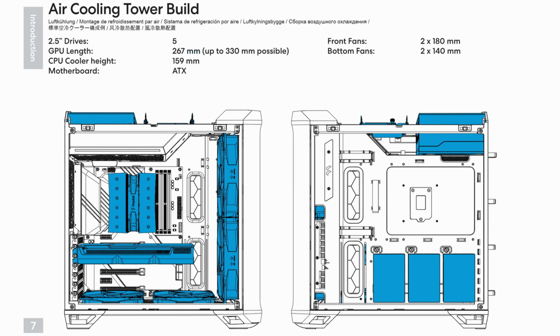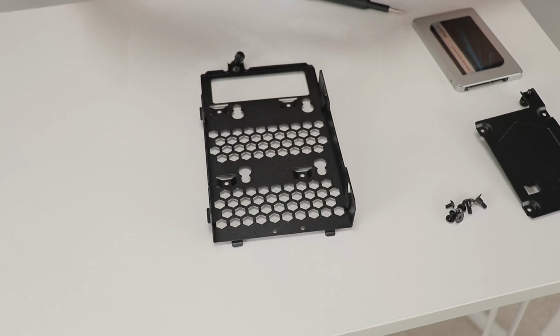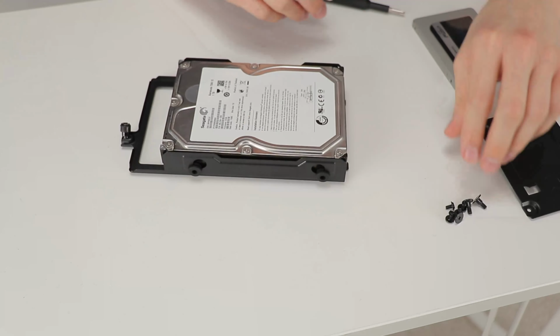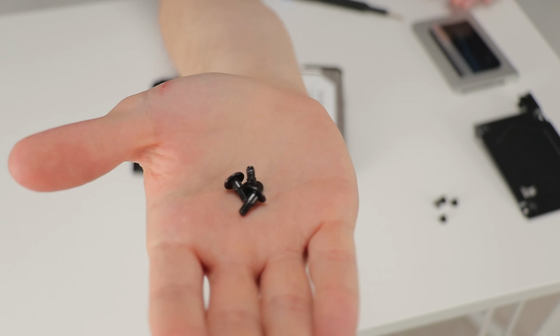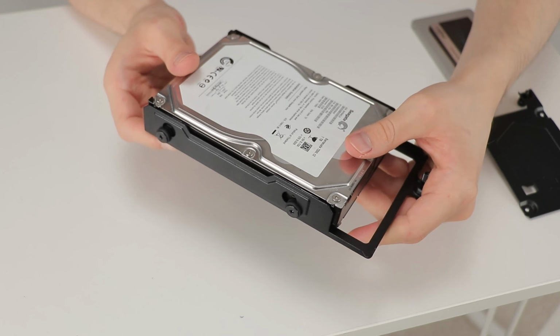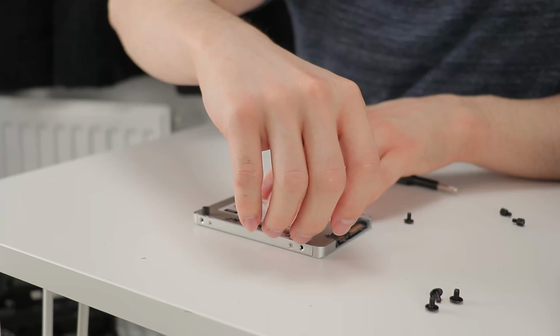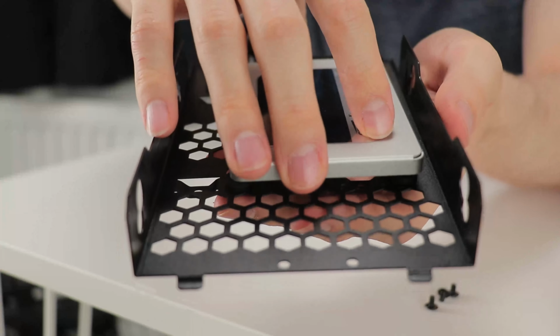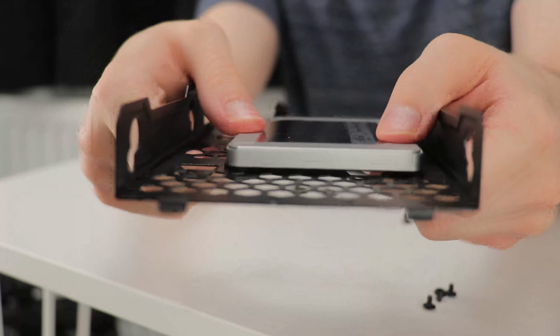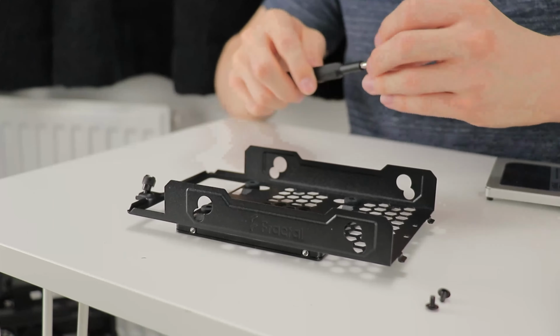Just clarity, please. Onto drives, and we'll start with the top drive bracket since it's our only support for 3.5-inch drive. And also rather interesting in the drive sandwich department. Starting with the 3.5-inch drive, the drive bracket houses grommets that take these long 3.5-inch drive screws, which I only received 3 of. They combine to achieve a vibration dampening solution, but it doesn't end there. You can remove the 3.5-inch drive, take the grommets out, and combine them with these knurled posts to create a friction-mounted 2.5-inch drive position. But it doesn't end there, since they've added these pressed-out offset mounts to provide screw head clearance to achieve the mecca of mounting solutions, the sandwich drive panel.